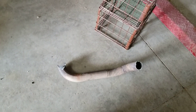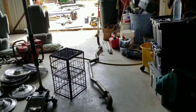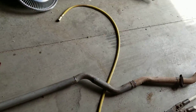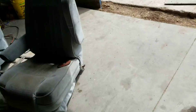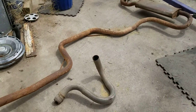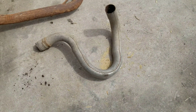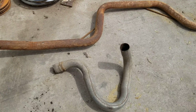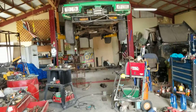Just because it's a little bit older don't mean it can't be worked. The only thing that sucks about pipe after it's been run is it's really hard to re-bend. So do it like it's an exhaust kit from the big store — you got bends, cut them out, make them fit. This one here was a crossover pipe and the mid pipe out of a mid-80s Chevy, but if you keep a little bit of old stuff around you always got bends you can work with.